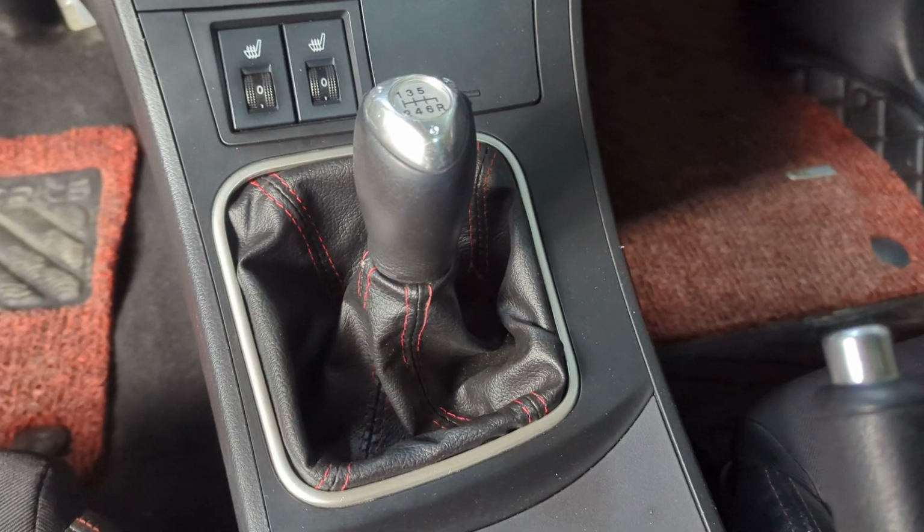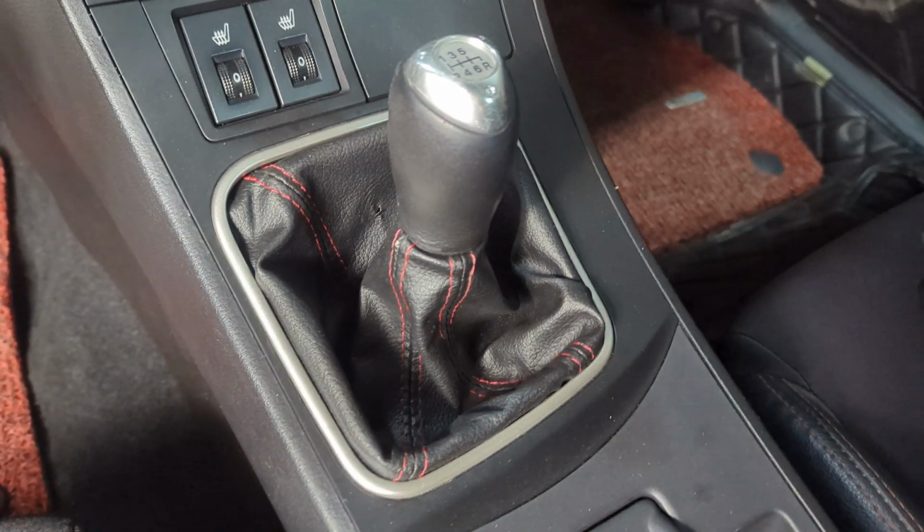All right, so fully modified Mazda 3 that doesn't go into gear. Okay, for the record, listen to me guys, the shifter is super stiff and does not auto center. Stock flywheel, stock clutch. I'm not sure why, but it feels aggressive. It grabs very, very well. Could be because of the rear motor mount. Oh, right. Because there's no flex with the engine.